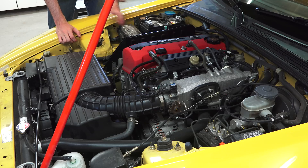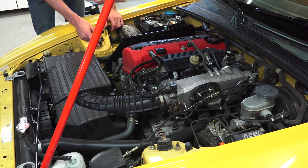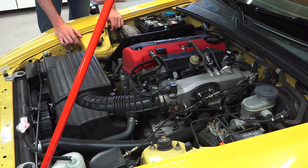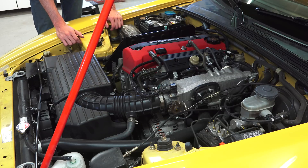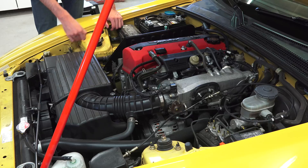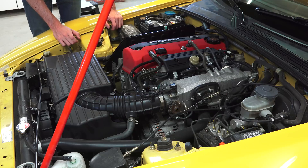The tech who looked over the car said the oil pan does need to be resealed. One interesting thing — Honda actually doesn't use a gasket with this oil pan; they use Honda Bond as an instant gasket, basically some RTV that you put around the oil pan and seal it up. That may be something I need to redo. I haven't seen it dripping oil so I don't think it's too bad, but it may be leaking a little bit, so no harm in redoing it.